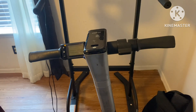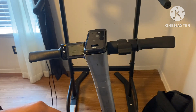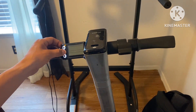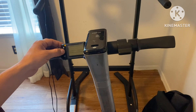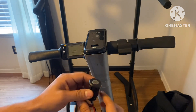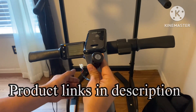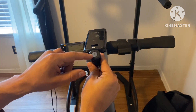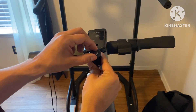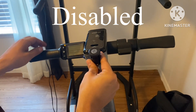What's going on YouTube — thank you for tuning in. What we're doing in today's video is adding a locking mechanism onto this Bird 3 scooter with the S866 display. Right now you can power it on and off through the power button, but the customer wanted a locking mechanism, so we're going to wire this into the ground connection of the S866 display. Unless the key is in the on position, there will be no power, and the throttle becomes useless.